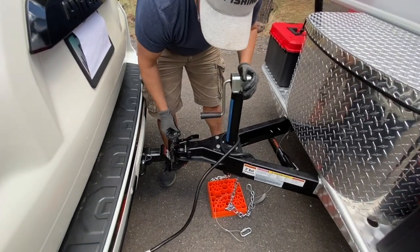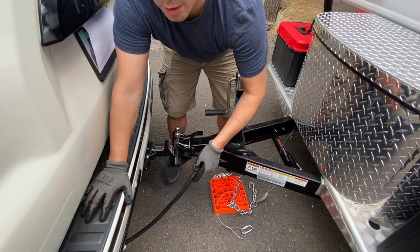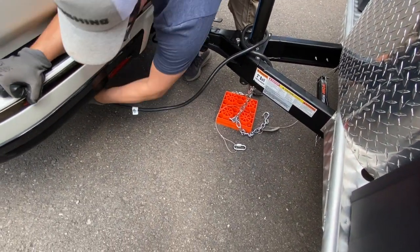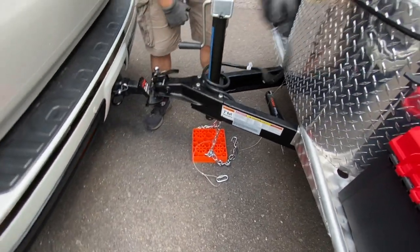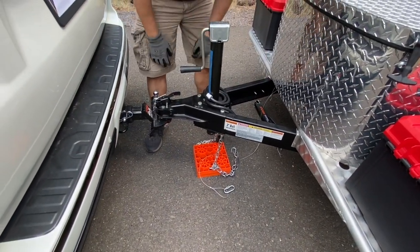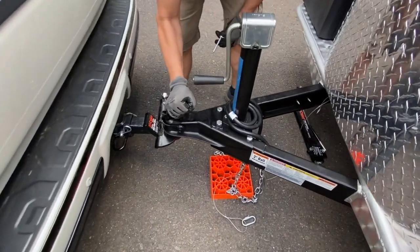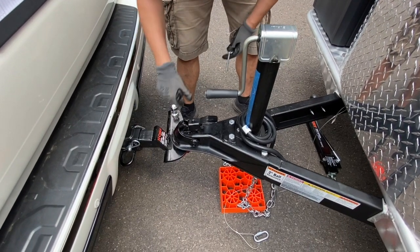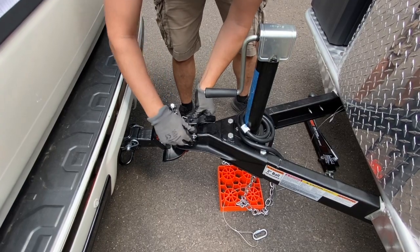We're going to do this pin. I always like to deal with the electric cable — you always want to unhitch it because it will drain your battery if you leave it on there. Go ahead and take that plug out, leave it off to the side, or wrap it in so it's organized and clean. Take out the pin and this lever here, try it up — now it's unlocked. When you place it back down, it's locked in. I always keep those pins together so you don't lose them.